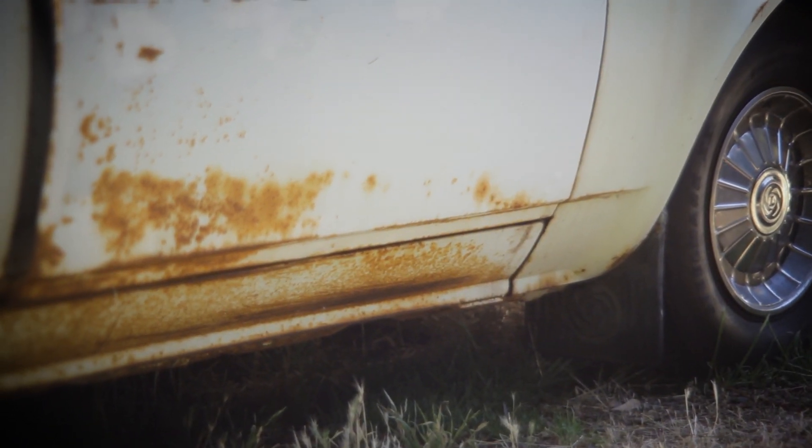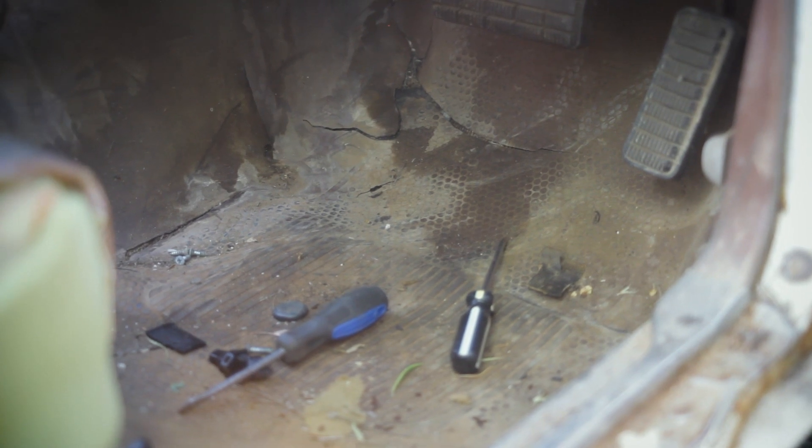The doors have broken through — they're gonna need treatment, but they're just flat pieces of metal so it's really inconsequential to fix those. Both front floors have some rot — not as much as the Jaguar, nowhere near as much as the Jaguar. It is there though, a little soft in the centre. That'll take me probably a weekend to do once all the vinyl floor is out. I think the only substantial rot in the car is this chassis rail, which is blown out on three sides where the sway bar mounts to. It's just box section metal, so it's not gonna be too bad. It's actually after the suspension joints, so when you jack the car up it's really inconsequential — it's not gonna fold.